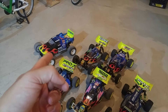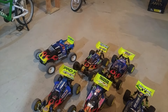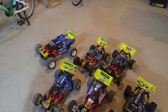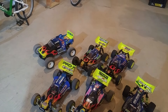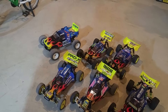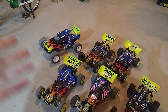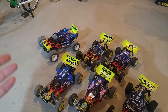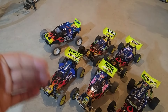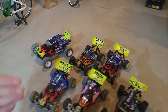For stadium truck, I'm going to keep it very simple and bring the RC-10T2. I've run the RC-10T2 a couple of times in the past, like 10 to 15 years ago, in the first several VORNATs. The first-gen 10T handles great but I don't really like how it jumps — the rear tends to bottom out a lot. But on my current T2 I have it mostly stock, which feels like a relatively light truck, so I don't think I'll have the same jumping performance problems. The rear tower geometry is different as well, so I think this will do better.